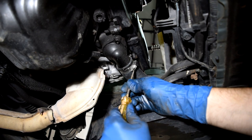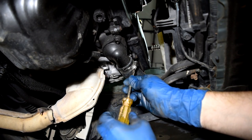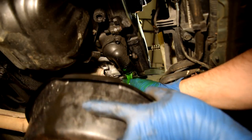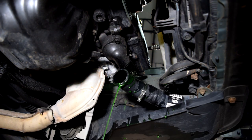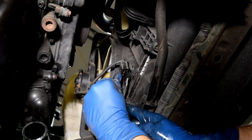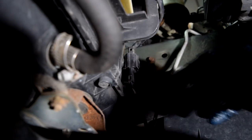In order to do that, we're going to have to drain the coolant first. I'm going to do that by undoing this lower radiator hose — just make sure you've got your catch pan ready because it's going to be messy. Next I'll open the radiator cap to help drain the coolant out faster. Now that we're down here, we're going to remove the electrical connectors for our radiator fans as well. This is the one on the driver's side — you do this by pulling out on the tab and then pulling on the connector. Same thing on the passenger side.